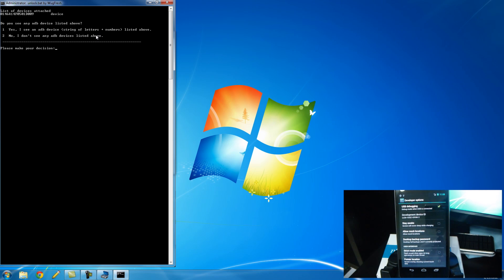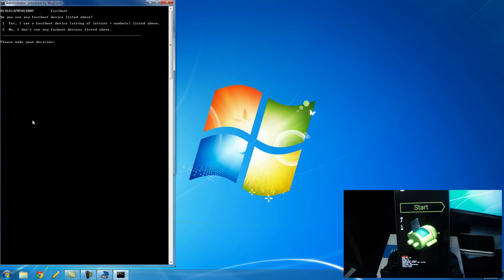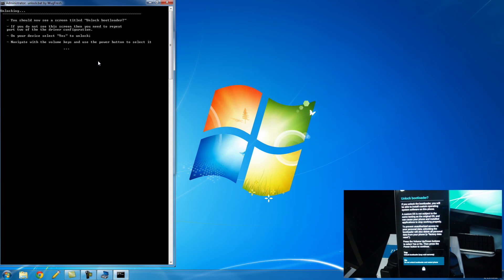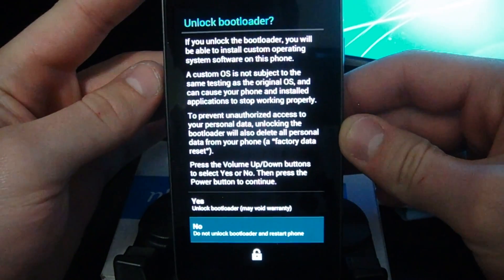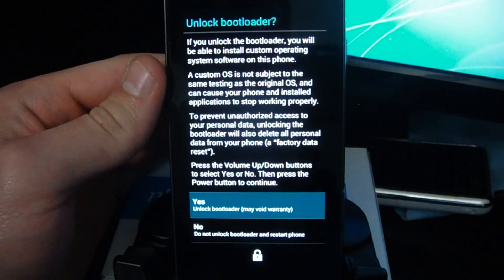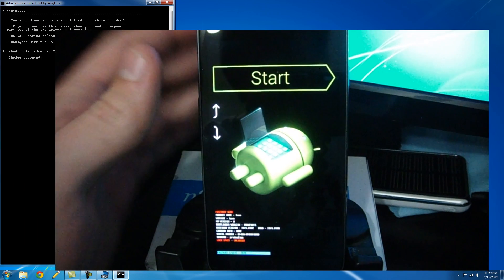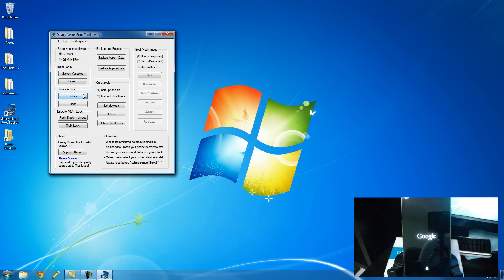It's going to check, make sure that it still has access to the device. It does — I'm going to go ahead and click 1, yes, I see the device. And it's going to boot into the bootloader so that we can go through the unlock process. It's very simple. It says you should now see a screen titled unlock bootloader. We're going to use the volume button to select yes, unlock bootloader. So I'm going to go ahead and hit the volume up button so that yes is highlighted and hit the power button to select it. So now that is complete, and we can go ahead and click any key to continue. Now that the device is unlocked, it's rebooting, and as soon as it's finished booting up, we can go ahead and continue with the root process.